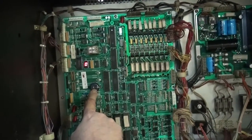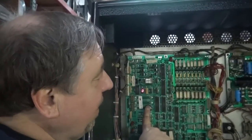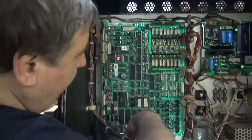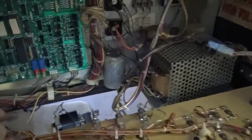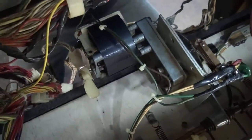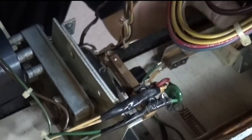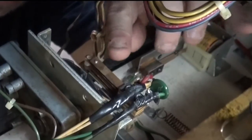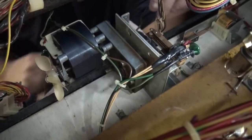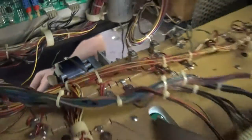Lithium battery here - we've put it in a holder so the customer can change it himself. You can buy that from the drugstore and it'll last about five years. Re-flow solder on all the edges, lead-free solder throughout the whole machine. You can actually see the reset motor from here. That reset motor resets all pins at once, then this switch engages - the computer fires it for a moment and turns off, and this switch allows it to make a complete cycle and stop itself. There's a brake built into the gearbox - very clever system, and it's worked great for many years.